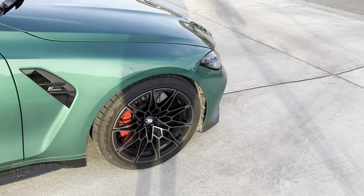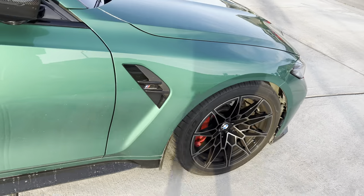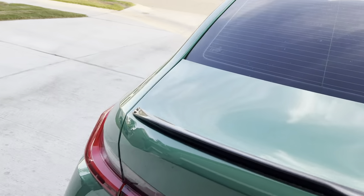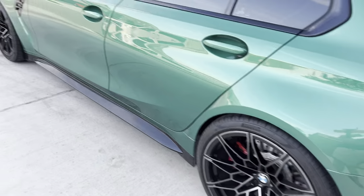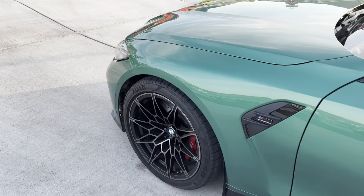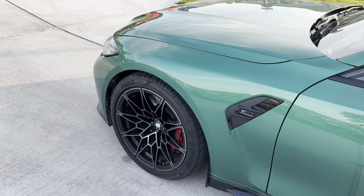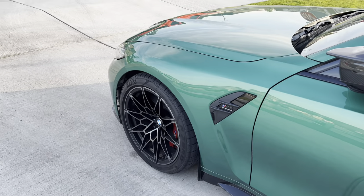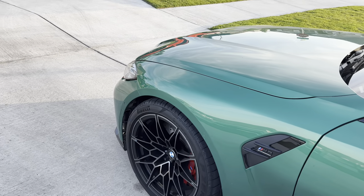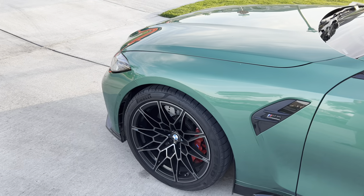Let's start with the main issue I found with this car and with a lot of cars that come with Brembos — the amount of brake dust they produce on stock pads. When I had the Hellcat, I changed the brake pads and it helped a lot. With these cars there aren't that many options: you can go EBC Red, EBC Yellow, or the iSweeps. A couple of G80s are now transitioning to different pads just to eliminate brake dust and for overall performance. I went with iSweep because on the forums they had pretty good reviews and no one had real complaints.